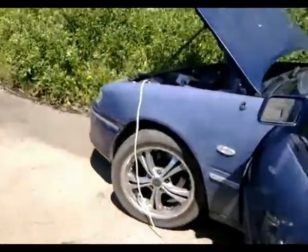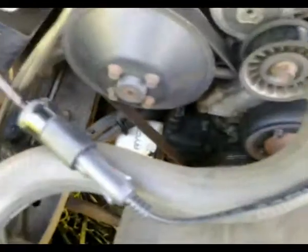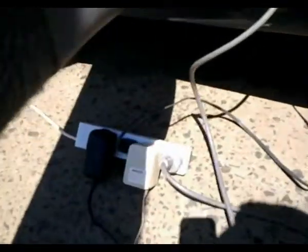I've simply connected a power inverter to my car's lead-acid battery for the adapter. Normally these plug into cigarette lighters, but because my cigarette lighter is busted, I'm connecting it straight to the battery instead. I've got it connected to the power inverter, and from the mains output I've got my equipment plugged into a power board.